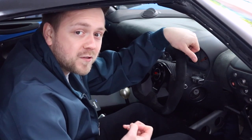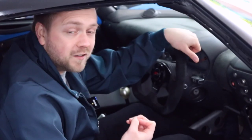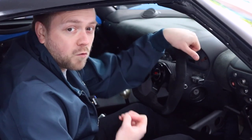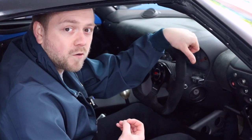On the test drive, if it crunches going into gear, that's a different story. Likely the syncros are getting tired or completely worn out and requiring replacement — that's a gearbox rebuild job and it is pricey. So make sure that's not the case. If the seller tells you crunching is normal, don't believe it. It shouldn't crunch going into gear.